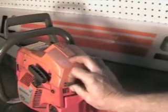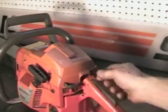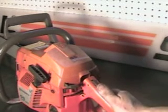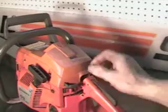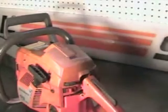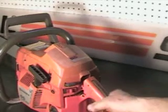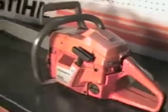The choke is right here, and when you pull that choke it automatically trips the trigger so you've got a little less than quarter throttle — so you don't have to have your fingers on the trigger while you're trying to start it. You just push the choke back in, it still gives it throttle, and you'll hear a little click. That takes it down to an idle when you hit that trigger — just a nice feature that came out with on the Husqvarna.